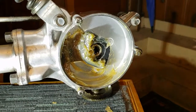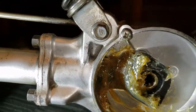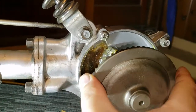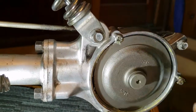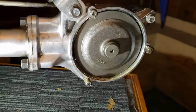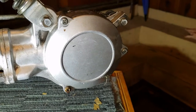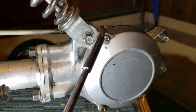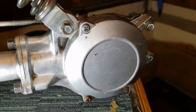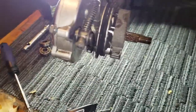We're back on the rear wheel here. I just finished putting some new grease in, filling that cavity, and this differential is going to slide right in there and sit. Next we're going to get this ring around there before we put the cover back on, then tighten down those three screws. It's got the seal behind there with the new grease inside — and that's a high temperature wheel bearing grease — so that's pretty much got this back end done.